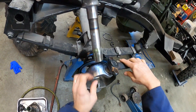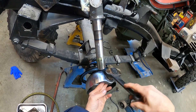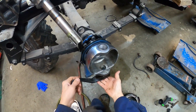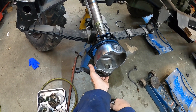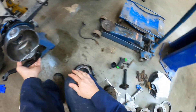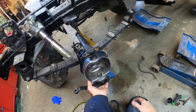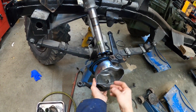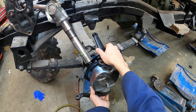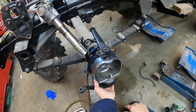These are the swivel pins — they fit in there. Newer Land Rovers I've worked on, and I think Toyota Land Cruisers, have a tapered roller bearing in there; the Land Cruiser might have had a bronze bushing, but it's been about 25 years since I had one apart. That's the lower steering arm fitting. That's where water is going to get down into that bushing, which is kind of a bad setup. With gear oil, the U-joint spinning in there is going to be throwing oil and lubricating these bushings. With grease, I think you might starve the top bushing of lubrication — grease is going to stick to the underside but won't work its way in there, whereas gear oil will be slinging in there all the time.